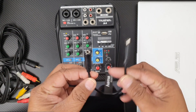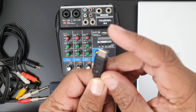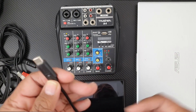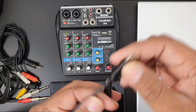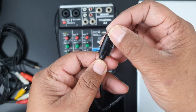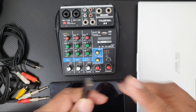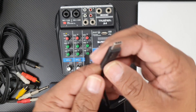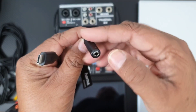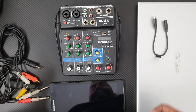The most important piece you need for this setup is a sound card. I'll be connecting the line mixer to my laptop using Type-C, but normal USB ports can also be used. If your laptop does not have a Type-C connection, you need a sound card with a 3.5mm slot on one side and a normal USB interface on the other. I'll leave the link to buy the sound card in the description. I'm using a Type-C sound card that has a Type-C interface on one side and a female 3.5mm jack on the other.